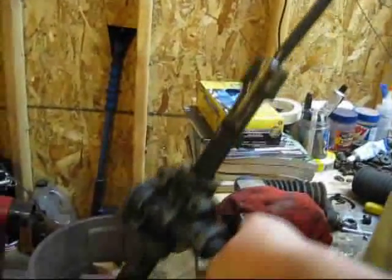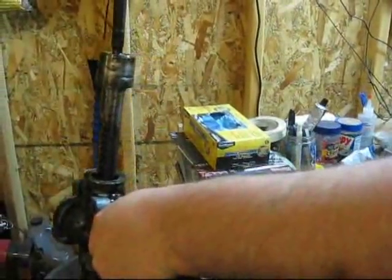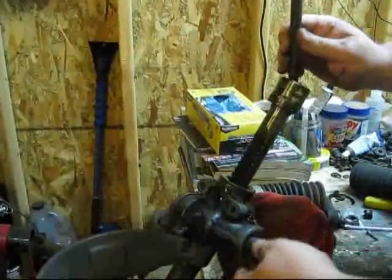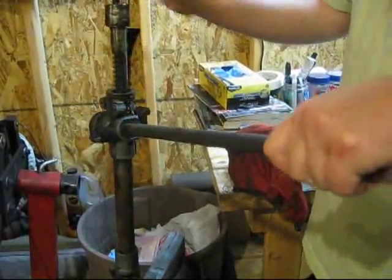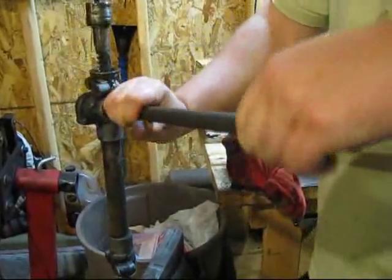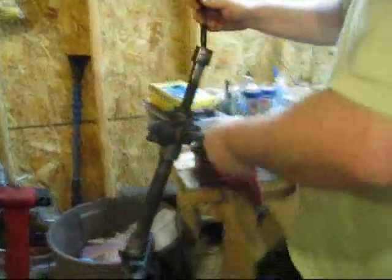And this is kind of cool. You hear the phrase rack and pinion all the time. Well, this is the rack. You can see it's a length, or I don't know, a horizontal axis gear, I guess. And then here is the steering column, and at the end of here there's just a normal pinion gear. And as we turn it, you can see it moves this guy back and forth, and that's what moves your wheels from side to side. So, pretty cool stuff. But I am going to put this in a vise now.